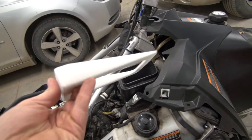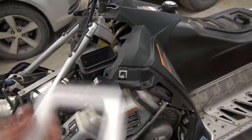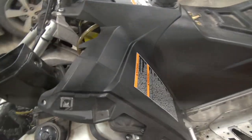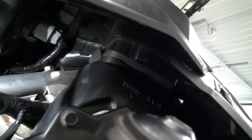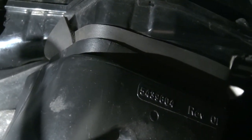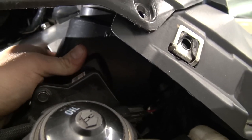Alright, here's the part - got it all designed and fabricated as you saw in the video. Printed it - took about four hours. This is made out of TPU filament so it's stretchy, 50% infill. Let's go ahead and put it on quick. We got it on - as you can see I left just enough for a little lip there, so when we put it on here there's that. And here is my sensor right there, so let's go ahead and plug that. Fitment is now phenomenal - it's sealed up and in there really nicely. Both sides - look at that. Besides that little part to the left that's driving my OCD nuts, she sealed up real nice.